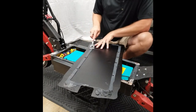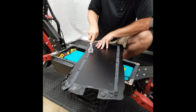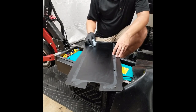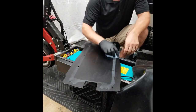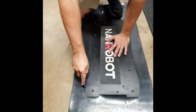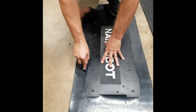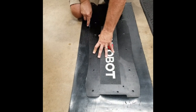I got it cleaned up as much as I could. Remember, we're just trying to prevent water intrusion — there's no way to stop 100% of the water coming in, so we're going to give it an honest effort. What I found works best is if you put the rubber sheet on a solid surface like the shop floor, go around it with the razor knife. I have this almost completely cut out — you want to be firm, press hard, and make sure the deck plate does not move.